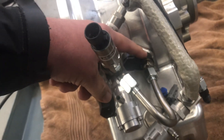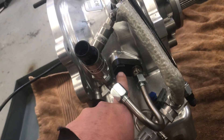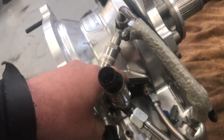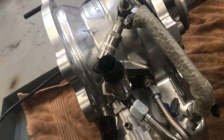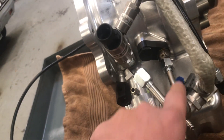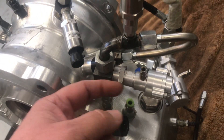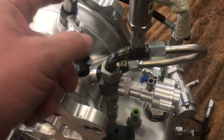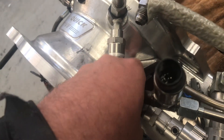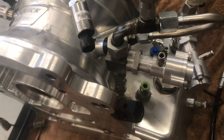In here is the outlet from the converter — this is the cooler out — and typically this would go to a transmission cooler and come back in through this port. The billet version has a jumper that connects the two so you don't need a cooler if you don't want one. On our car I have a dump valve tied into that circuit; this line goes to the dump valve, which is air-actuated. At 150 PSI it opens and allows cooler pressure coming back from the converter to bypass the restrictor jet inside the case and go straight to the pan, loosening up the outlet side of the converter.